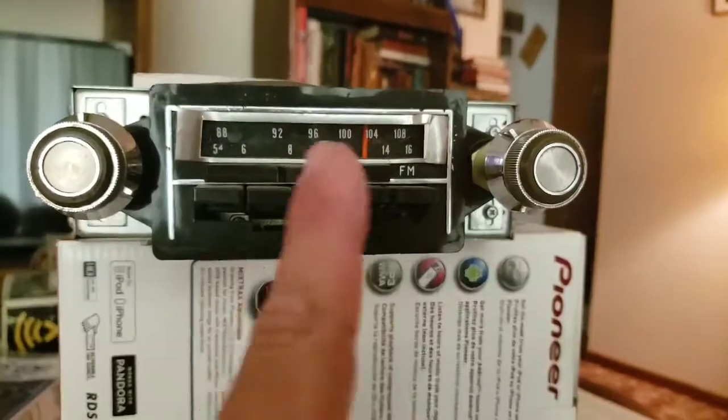It's a common misconception that stereos are car specific. What a lot of people don't realize is that a Ford stereo and a Chevy stereo are a lot of times built by the same companies - Blaupunkt, Delphi - they all make a lot of stereos. My Peterbilt stereo is made by Delphi, which is the exact same stereo that's in a Volkswagen and an Audi. So all that aside, if you have a wiring harness you can actually hook a stereo from any car into any other car - it's really quite that easy. I used to have a square face stock Ford stereo out of a Thunderbird that was in a Dodge pickup.